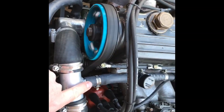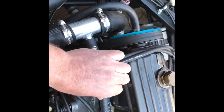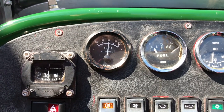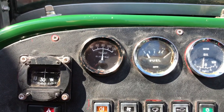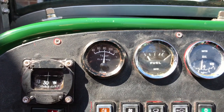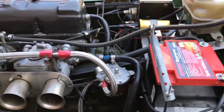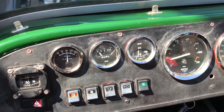You'll see me do that when I start the engine up. I've got the top hose on the T-pieces here. There's a skid of water coming out there - no air. So it's sitting on 80 degrees, just where I wanted it to be. Now having installed that new thermostat - the lower temperature one - the fan's on, it's now sitting at a nice stable 80 degrees. Twenty minutes with the engine running, dead on 80. So I'll take it for a drive. Join me next time. Thanks for watching and please subscribe. Bye, thank you.